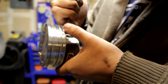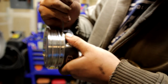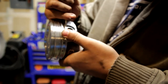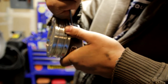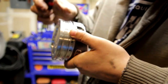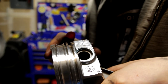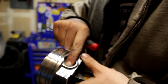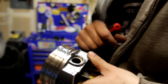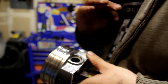Now we're over here again, and I could push this down up here and get that last little bit. You will get a little bit of scoring, but essentially that's what you want to end up with right there. And you're just going to turn it over, push your wrist pin all the way back against that lock that we just put in, and put the other one in the same exact way.